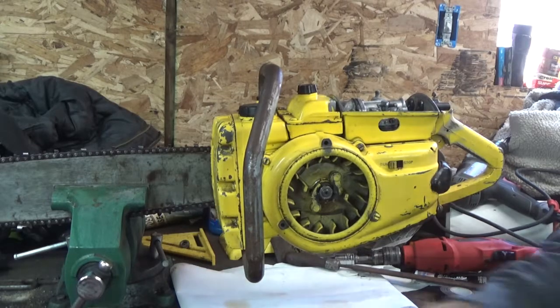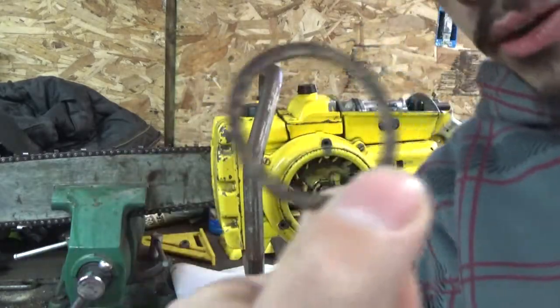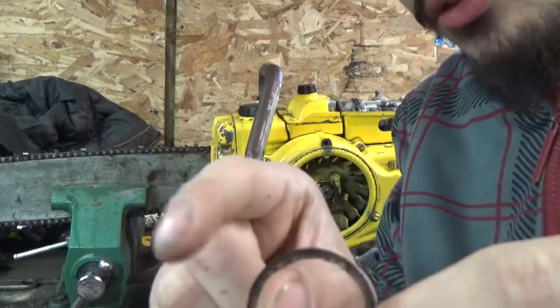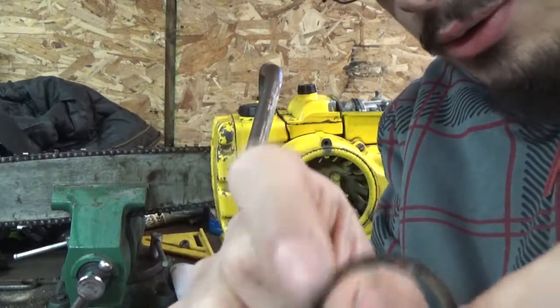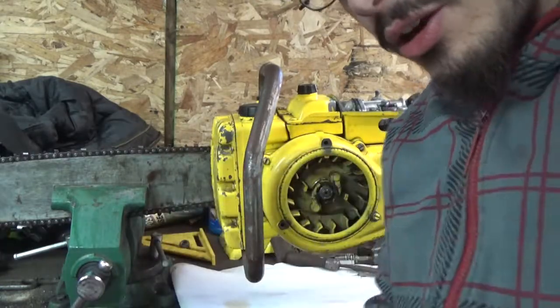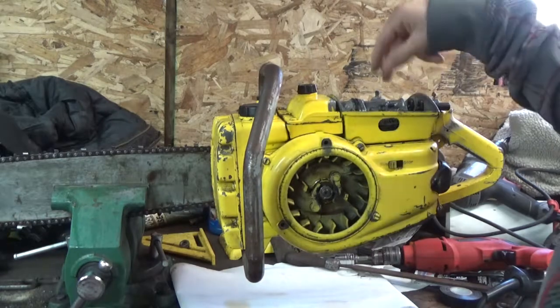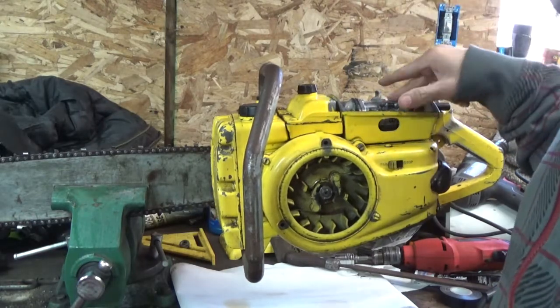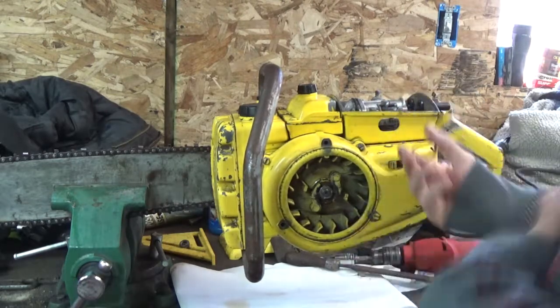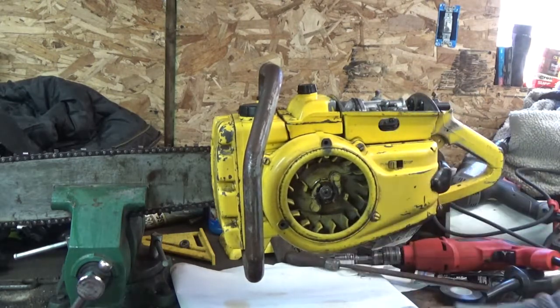of the carburetor, guys, there's this O-ring. You probably remember this old one at the very bottom of that carburetor. Well, the new one was thicker, or wider, whatever you want to call it. Not thicker, but wider. It wasn't seating right, so I tore it all back down. I should have blown in it to make sure it was seating. It wasn't seating, so I took it off, went through it, kept trying to figure out the problem with